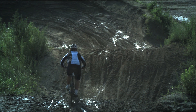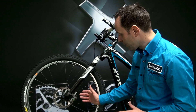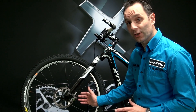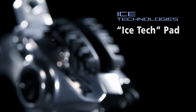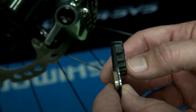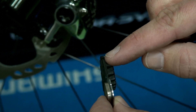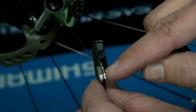How are we able to do that? First, we design the caliper in such a way that it can accommodate brake pads that are specially designed to reduce the temperature. It is a brake pad with a cooling fin on top. But it is not only about the cooling fin — it is also about the choice of materials.